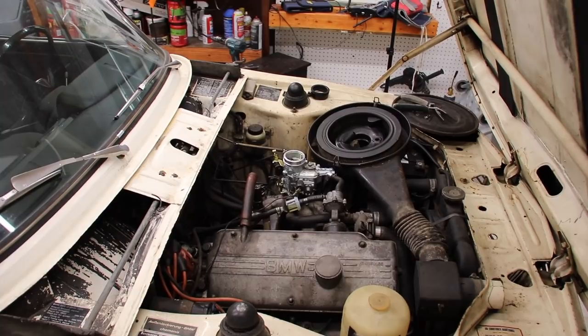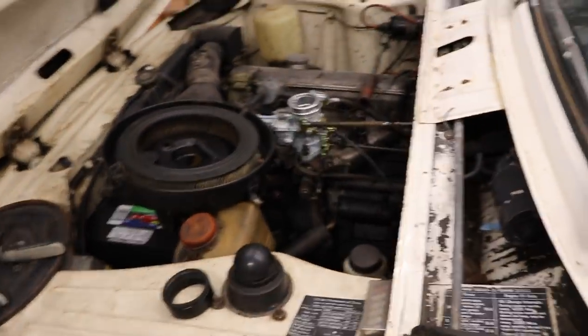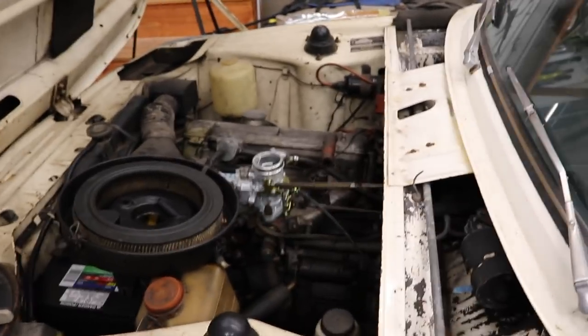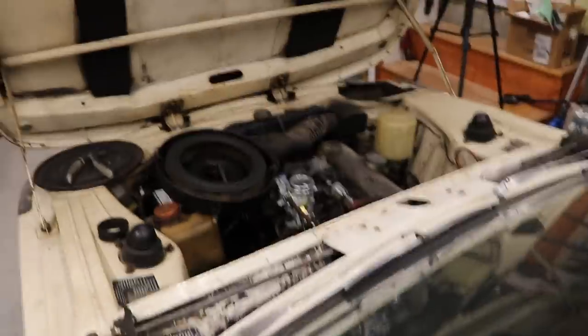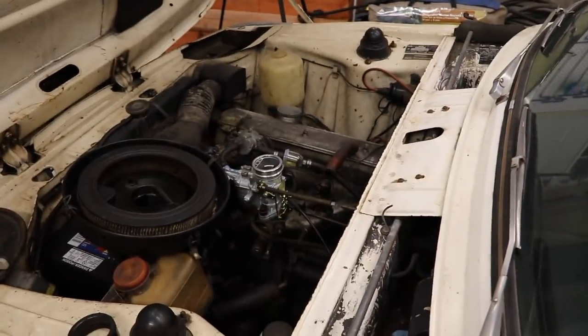Let's back her outside and let her warm up a little bit. We've still got a little bit of that action going. I'll probably need some spark plug wires, points, and distributor work. I got the carburetor adjusted pretty good, got the idle adjusted pretty good — still a little backfiring. We might need a little bit of timing put in it too. Kind of a funky video because it's not on a car that anybody really has, but that's putting the carburetor on. Everything seems pretty good. I think we're going to order some ignition points, spark plug wires, and take a look at the timing — maybe a cap and rotor. I think that would make it a lot better.